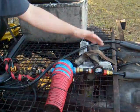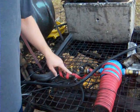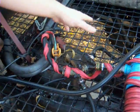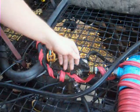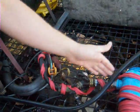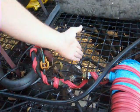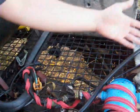The dirty tank goes through the pump and the filter, and there's a few ways you can set this up. If you have it shut off here, the engine's not going to be getting any fuel. Open both of these valves and you'd be having dirty vegetable oil filter straight into the clean tank, so you can be sitting in your house and having it do that for you. You can open this and it'll be driving off of it. Typically if you close the clean vegetable tank and just try to run off dirty, it'll starve the engine for fuel — you won't have enough power to stay at 70 — so you want to have them both open. When you're on the highway it'll suck some from both; it'll suck all of it from here and then some from here. But as you slow down in town, it'll start building a surplus and it'll actually be filling your tank while you're driving.